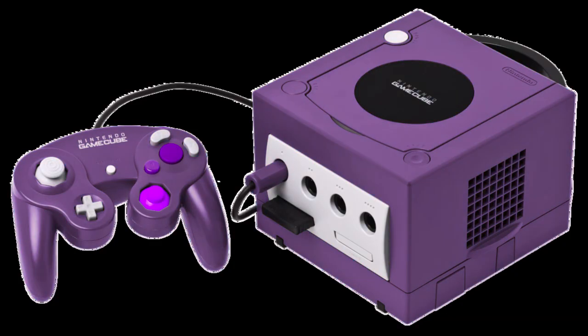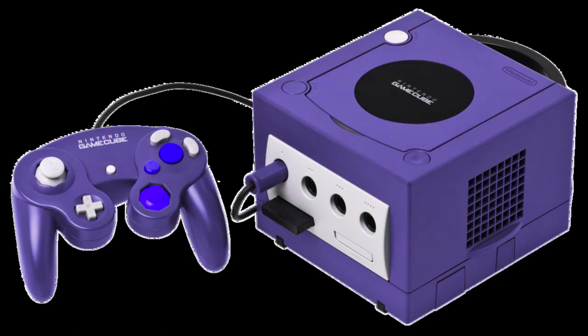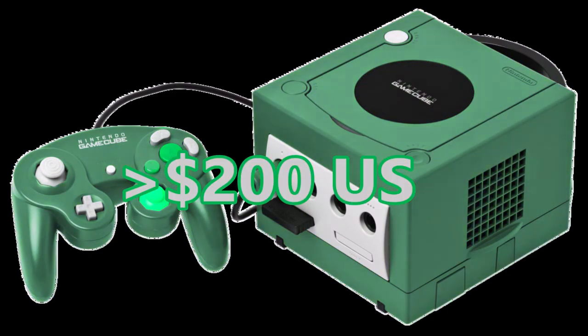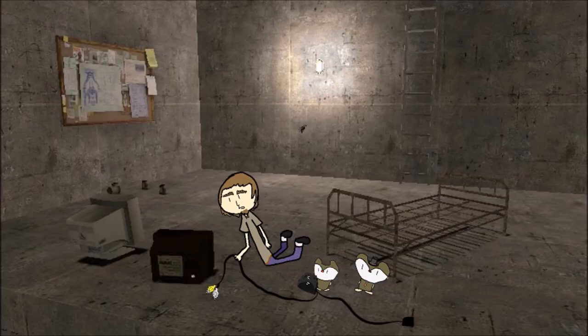The GameCube's component cables use a very strange and proprietary converter in the cable itself, which plugged into a special digital output next to the AV port, which the GameCube shares with the Super Nintendo, AV Famicom, and Nintendo 64. These cables were only sold on Nintendo's website in the early 2000s and have long since been discontinued, and are now being sold for over $200 on eBay. Even worse, the digital output was removed in later GameCube models, as it was seldom used, so with the GameCube I'd stick to S-Video in NTSC regions and RGB in PAL regions.